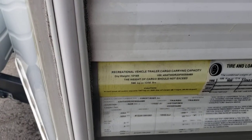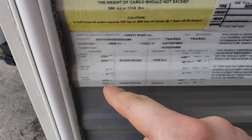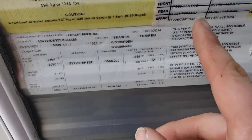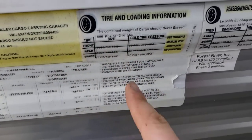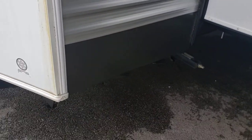There's a spot over here for some important information. You can get your VIN there. Tire pressure is 65 psi — keep your tires at that pressure. Don't go by what your tire itself says; go by what this placard says.